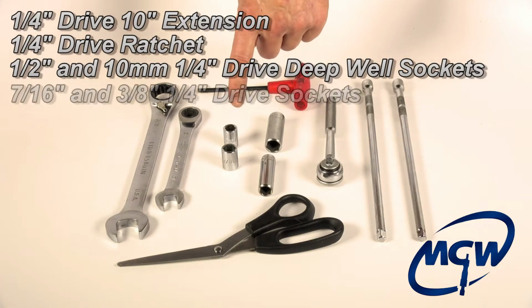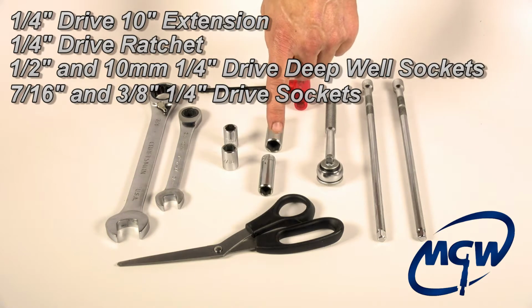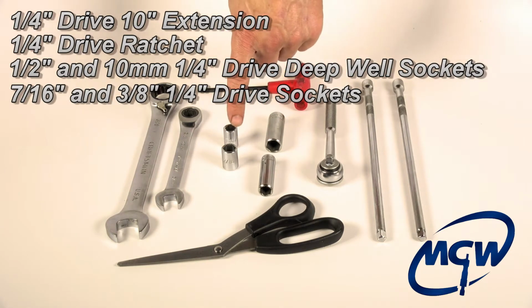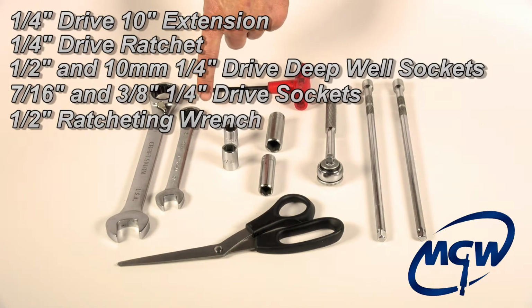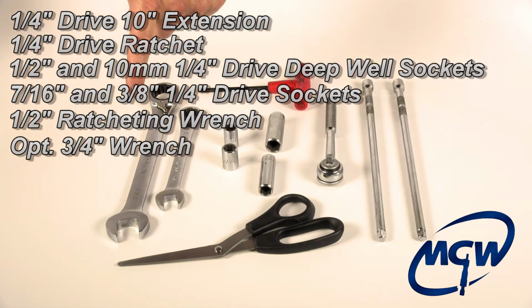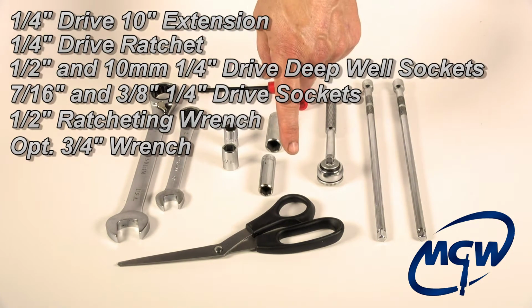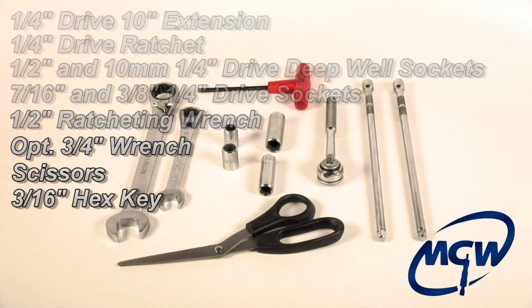These 2 sockets we prefer not to be deep well. That is the 7/16 and this is a 3/8. So we have a 10 millimeter deep well, a 1/2 inch deep well, a 7/16 standard, and a 3/8 standard. We also have a 1/2 inch open end wrench on one side and a closed box ratcheting type on this side. This is very important that you get a ratcheting style for the 1/2 inch. You also need a 3/4 if you're going to install one of our MGW shift knobs with the deluxe jam nuts. It does not have to have the ratcheting part because we will only use the open end. We have a pair of scissors, and we have a 3/16 T Allen wrench, and that's the entire kit.